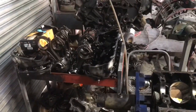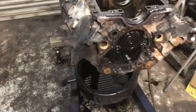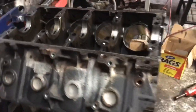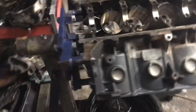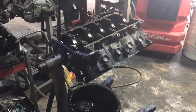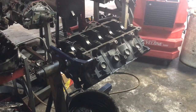Well guys, we're going to go ahead and call it quits for the day. I already tore it up — I'm going to pull that cam off and send this block in, get those cam bushings, get those heads surfaced and cleaned, and get that crankshaft reground. I'll get back to this one hopefully maybe Friday. Alright guys, appreciate you watching — like and subscribe.